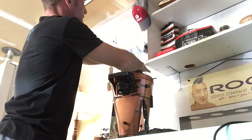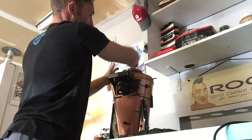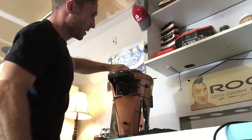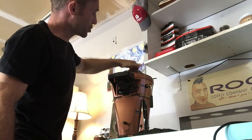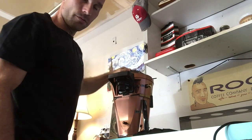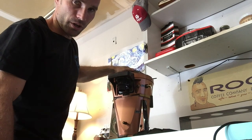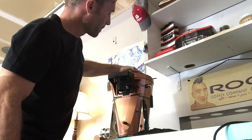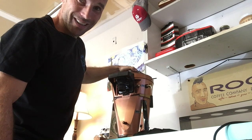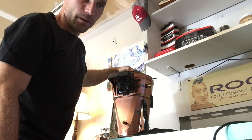This VTA-6 model is rated for Turkish grinding coffee. They sell separate discs — a Turkish disc and an espresso disc. Because of the size and versatility of this machine, you're able to specify your use case. If you're always doing espresso or Turkish, you can do that and it'll just extend the burr life. But the general burrs they sell are also capable of doing all of these. If you tighten it right down, you can feel metal to metal — you want to back off of that a little bit, maybe half a centimeter.